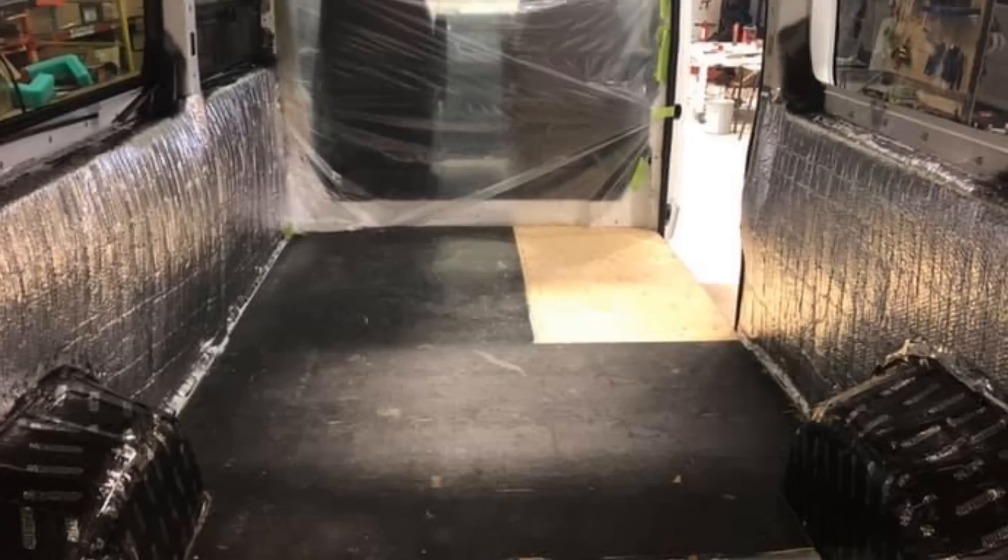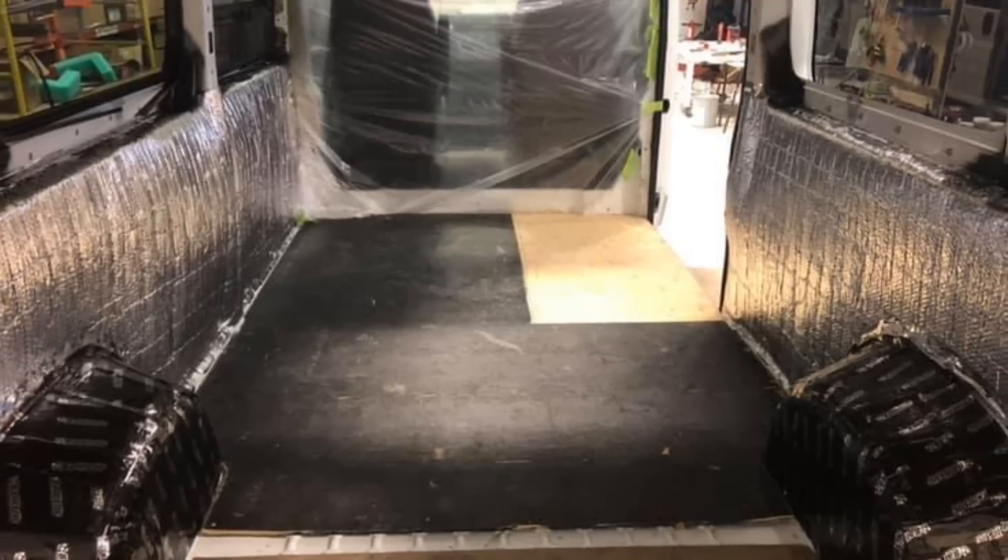You'll also want to make sure the flooring and ceiling have adequate insulation — those are both metal as well. Here you can see a layer being put down on the floor as a thermal break. The best way to know about this is to look at a manufacturer's website or Facebook page, like Panoramic has. If they do good insulation, they'll usually talk about it or show it. Look for factory tour videos — sometimes they'll highlight it if they're proud of it, and that'll give you a good idea of how well insulated the van is.